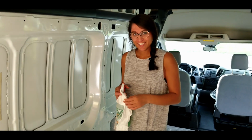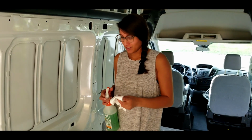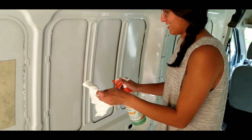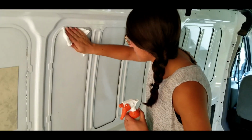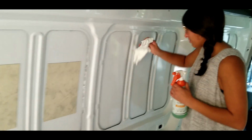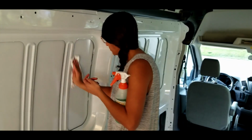Rundown. Give them the rundown. Do you have any examples of this rundown? No, just a standard rundown. Get on it. Yeah, I'm working really hard on this rundown. So Sejal is going to degrease the walls, and we're going to lay down our sound dampeners here all along the surfaces, any surfaces that can vibrate or shake. So ceiling panels, it came with some already on these back panels. For some reason they do the back couple windows or would-be windows, but they don't sound dampen anywhere else. So we're gonna work on that, and I'll try and time lapse it.